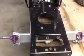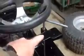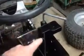You can see my steering column and my shift linkage. I like to move the shifter up by the steering wheel so it's easy to get to — easy to shift up and down. All it is is a piece of 5/16th rod, threaded. I take a piece of flat bar, weld on those little collars from the hardware store with a set screw, then put a jam nut on the bottom and a jam nut on the top so I can adjust the height.